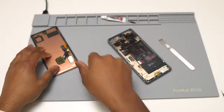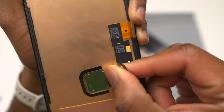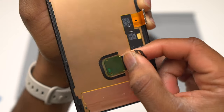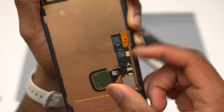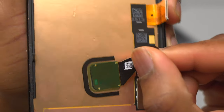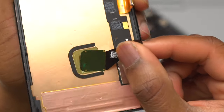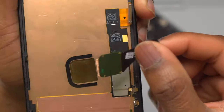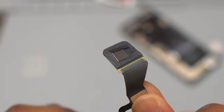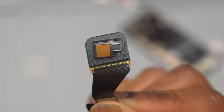I didn't use alcohol because I don't know the consequence of using it on this fingerprint sensor. If you use alcohol it will go under the fingerprint sensor and touch the actual sensor, possibly leaving stains — which is never good for an optical image sensor. Always go back to the hot plate if you find resistance. One side of the fingerprint sensor is now completely free, and after removing the other side, the fingerprint sensor is completely out of the screen — clean and ready to be reused.